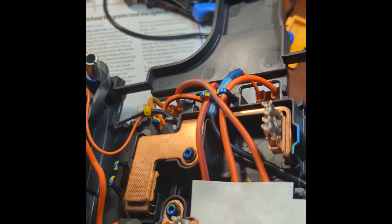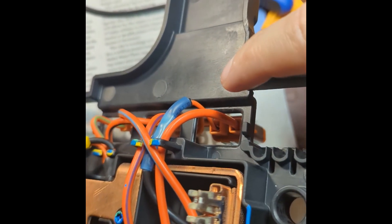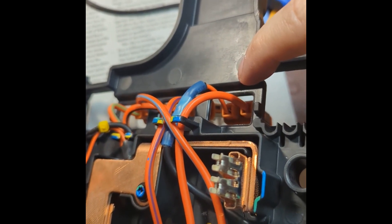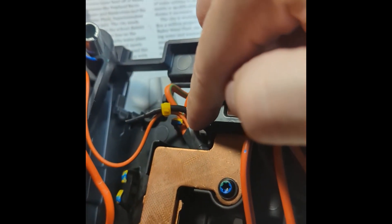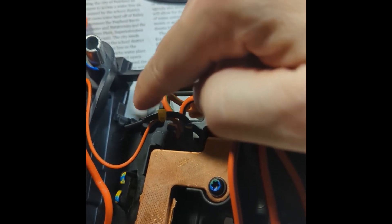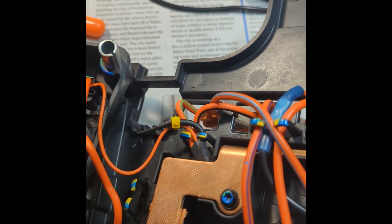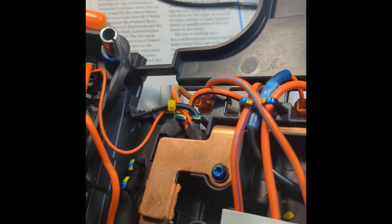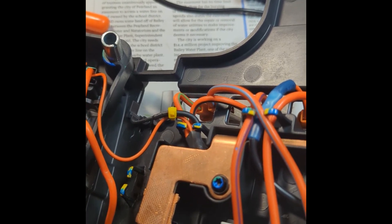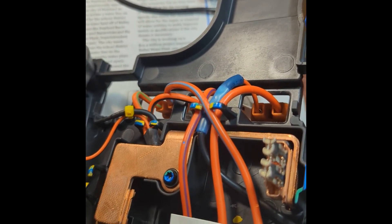I just rewired the negative wire off the charger instead of it being hooked up to the bundle that goes to the negative contactors. I'm reworking mine because there's a complication between the VCU and the MCU and having to close the contactors when you plug in the charger. The VCU is enormous - I went back and forth a ton of different ways about how to wire this up and talked to the Thunderstruck guys.